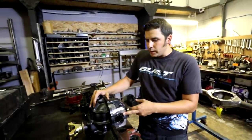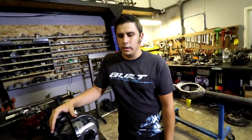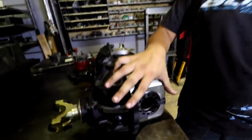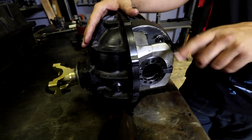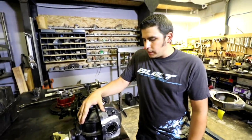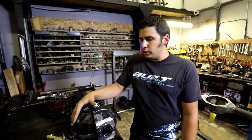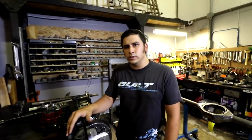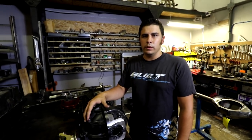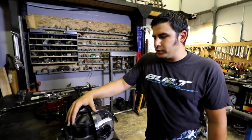Oh, okay. So what's the biggest spline axle this can do? They make a couple conversions, but typically you're limited to like 31 spline. Gotcha. Yeah, so this one will hold 35 and 40 spline really easily. That's the typical journal size. It works well with these, and because they're bigger bolts, more material, it's pretty hard to kill these. So these are good. We in fact stuff 10-inch gears into these in a couple Ultra 4 cars and things like that, and they hold up really well. So an aftermarket case, a 3.25 race case is what it's referred to, is a great upgrade.